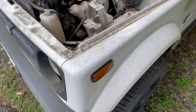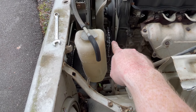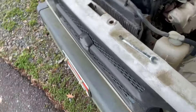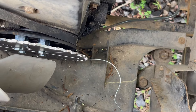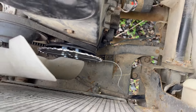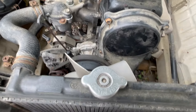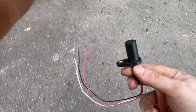What I've been working on today is getting my DIY auto-tune trigger wheel kind of mounted. I've been testing it a little bit — you can see I've got some bailing wire. It's only about a mil to a mil and a half away. I'm trying to get this thing to where I can mount this hall sensor here.